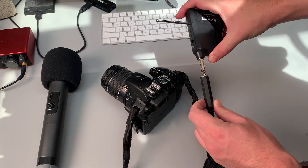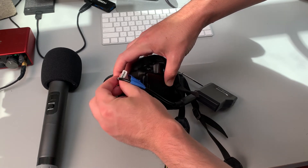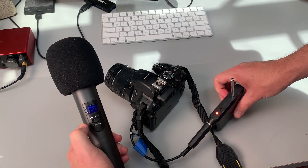You can then open the camera app on your iPhone or smartphone, begin recording a video, and the audio captured will come from the K025. Now let's go over connecting the K025 to a DSLR camera. The camera I have is the Nikon D5300 with an 18mm to 55mm VR lens — I'll put links for those in the description. The process is almost the same as the iPhone, except you connect the receiver to the quarter-inch to one-eighth-inch TRS adapter and plug that into your camera's mic input. Then begin recording and the audio will come from the K025.